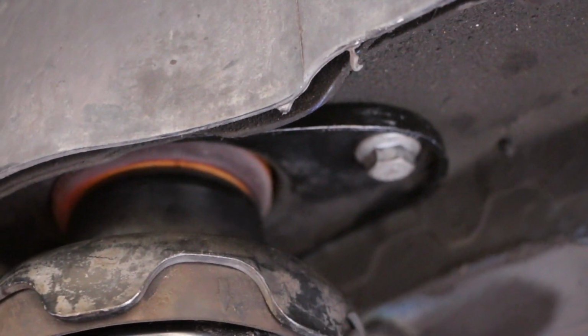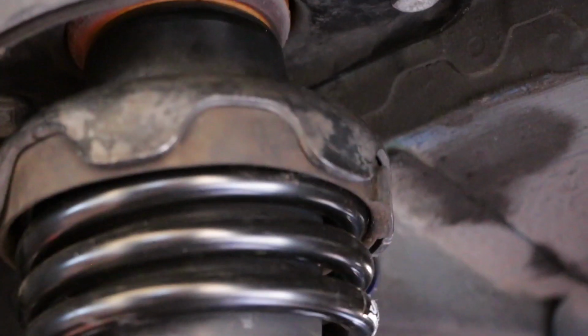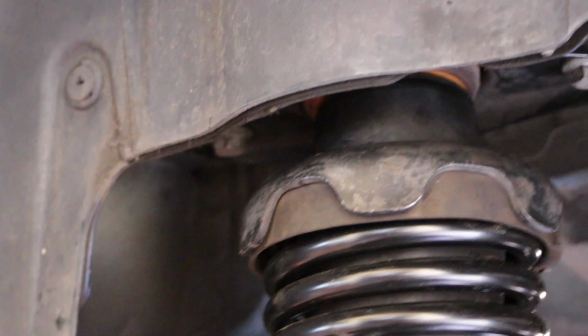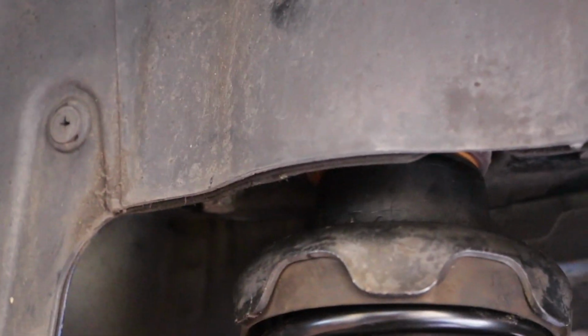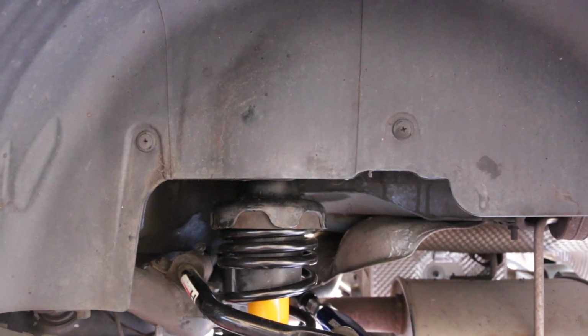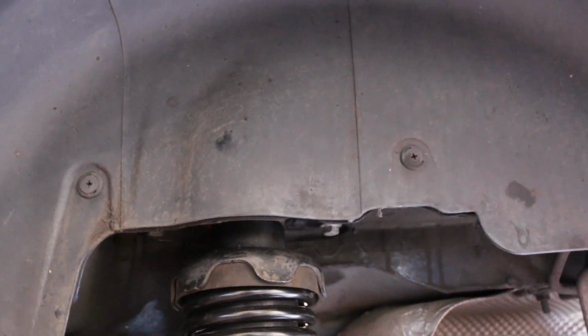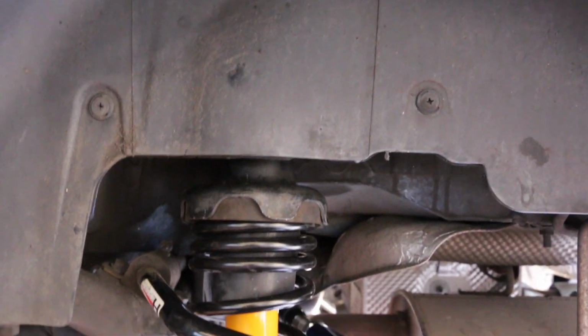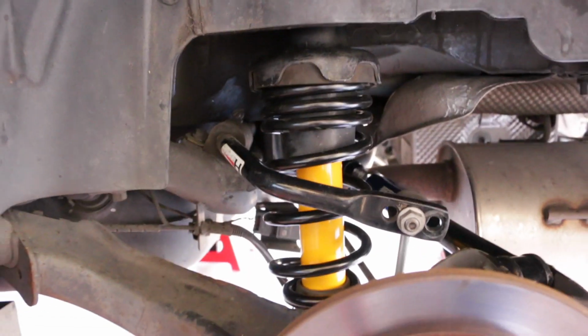Oh, I didn't tell you guys. The conical washer that sits right above this, can you actually see it? No. It's right on top of that foam that sits on top of this metal plate, which I told you guys you'd have to drill if you get the Koni yellows. That conical washer I installed upside down because I have an affinity for pain and suffering. If you do too, don't forget to like and subscribe. But I'm going to have to take out both of the rear struts again and flip that washer over, reassemble the strut, reinstall it. Huge pain.